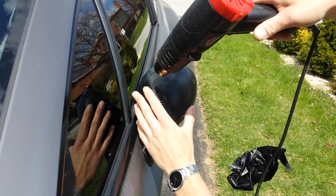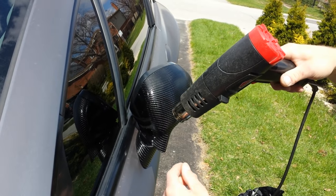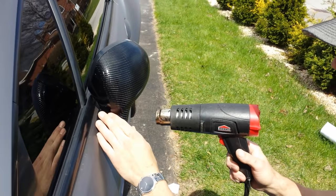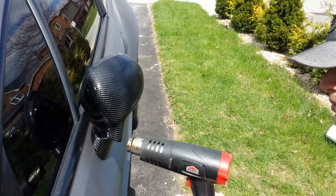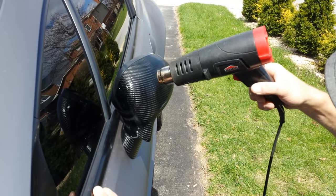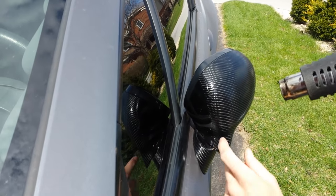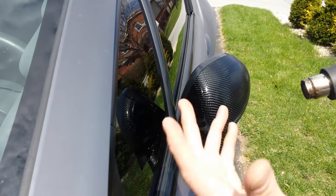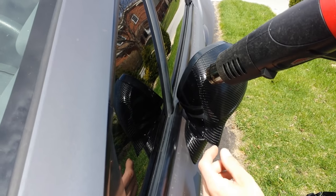Also, what this post heating is doing is sealing all your edges. The vinyl has little air channels in it, and if those air channels don't melt they can actually let air back in — so you want to seal those edges up. I've been doing this quite a while now and have a pretty good idea on how much heat it needs without the gauge. The gauge helps but I forgot to bring it today. Afterwards you'll just trim this away and put another piece here. Try and get it to go with the grain of the carbon fiber, or if you're just using a regular color it's very easy — overlap it about an eighth of an inch and you're good to go.